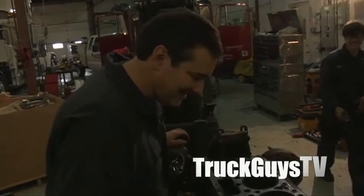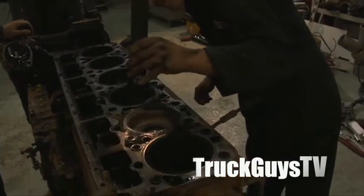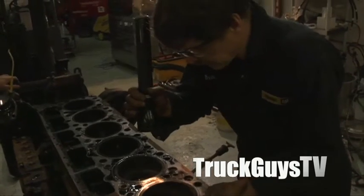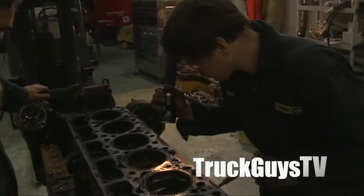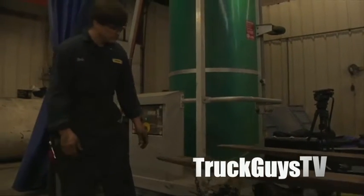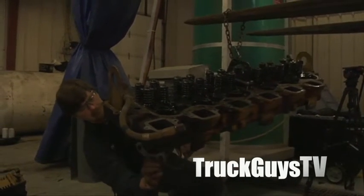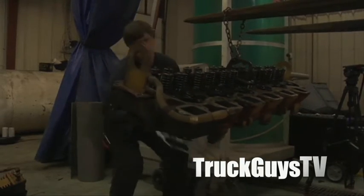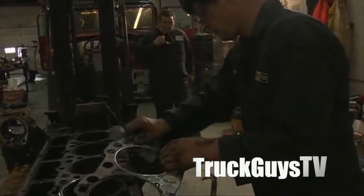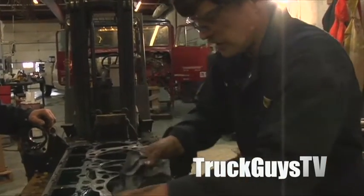There's a mouse in here. Lots of crosshatch left, Phil. Looks in good shape. I'll have to lift that head up and pull the gasket off so I can take a look at it. What I'm looking for is any discoloring in the fire ring right around here - that'd be signs of a compression leak.